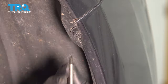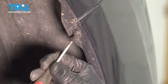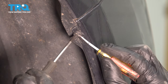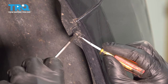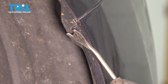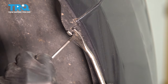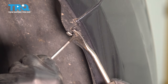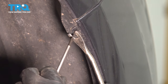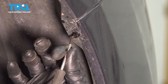With that loose, you'll see a little Phillips head push clip here. So with a small screwdriver, try to unthread it. If it doesn't want to unthread, you're going to need something to help pry it out as you unthread. This is most of the time too small for a trim tool, so I can try to use this, but the head of it is pretty much going to slide right through. But if you can get it unthreaded just a few turns, you should be able to pop the rest of it out. Sometimes spraying a little bit of rust penetrant in there can help — then work it in and out.